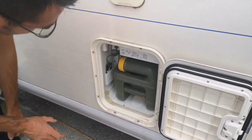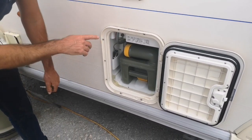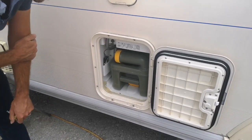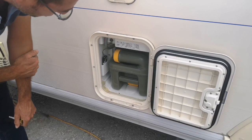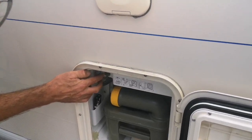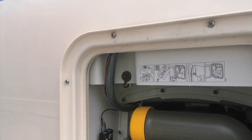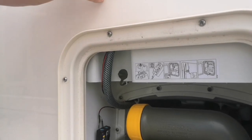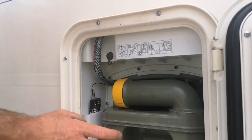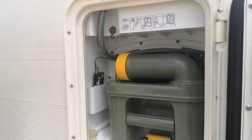On the side we've got two AA batteries that will light up a little indicator on the toilet inside. As the cassette is getting to the full point and needs emptying, the little light will illuminate. During the winter, there's a little drain-off bung at the side here. Take this out and that will drain the water off over the winter, draining all of your flush water straight out. If you remove the cassette and put a little bowl in, any water that dribbles into this area will just be caught by that bowl.